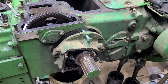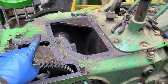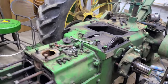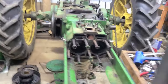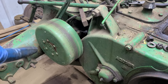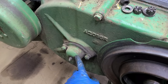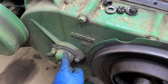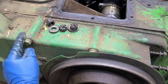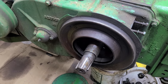Well, I lied — the crank is hitting on the inside, so before I can take it out I have to undo the main bearing on the other side. We've got to take the brake off because it's in the way of the first reduction gear cover. Then take off the nut for the first reduction gear and remove the first reduction gear cover. Let's go for it.